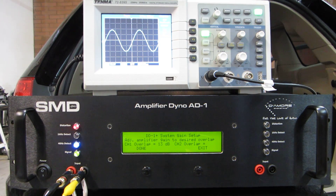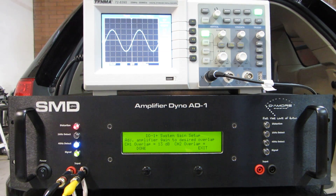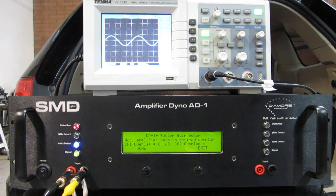You need at least 5 dB of overlap because all music is recorded below zero — it has to be or it'd be clipping. So I like it at 6 or 7. On the original DD1, 5 seemed a little weak sometimes and 10 seemed a little much sometimes, so let's go for 6. 10, 9, 8, 7, 6 — perfect. And that's it, the system is set up. My Rockford 2500 now has 6 dB of overlap set in the system and my head unit maximum volume is 30.